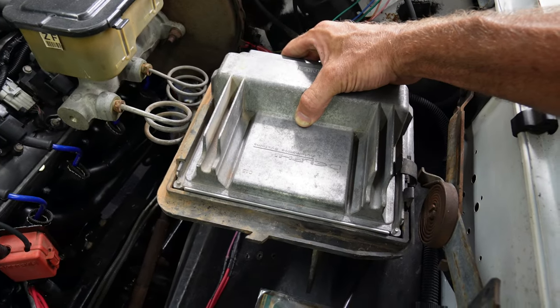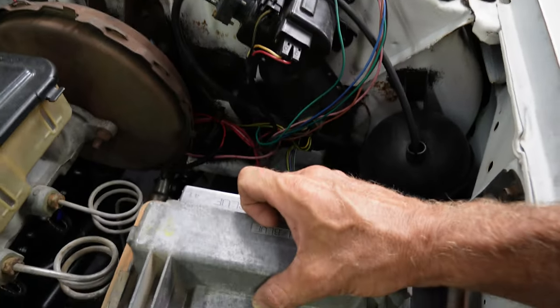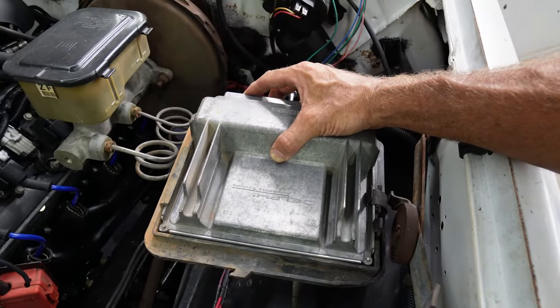I'm going to take this other Cadillac over to Killian's — we're going to drive them until they're gone. Now that the piece is glued in on the cab, Chase has gone doing Shark Tank things at Westwood High School, so I'm going to get back into the engine compartment and try to relocate this computer. My first step is building a little bracket — this is a crude cardboard template of the shape. I'm going to cut it out of 16-gauge sheet metal and get it bent up. The goal is to mount this computer right here in the engine compartment, clearing the hood hinge and the brake lines, with all the wires coming out the back side hidden.